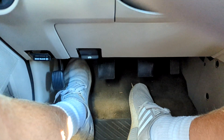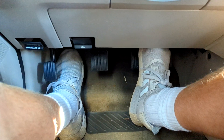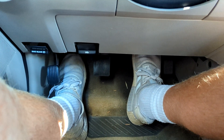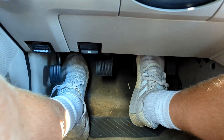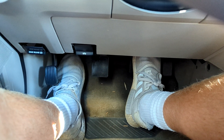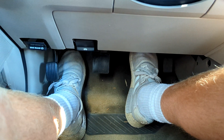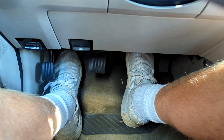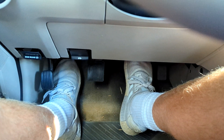I just ran the pump for about 30 seconds. Now if I press on the brake pedal — if you listen closely, you can hear it sounds like a release of air. That's the vacuum being filled. And I was able to push a lot further down than before. So it's a lot easier to brake now than it was without that little 12 volt vacuum pump.